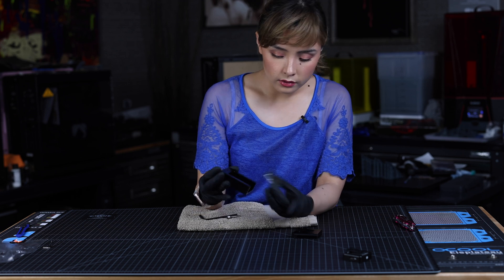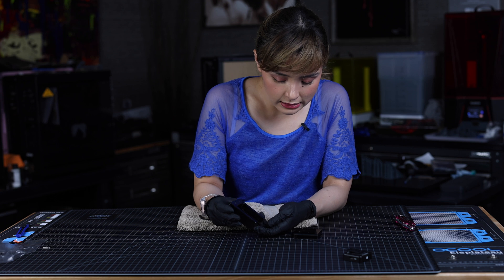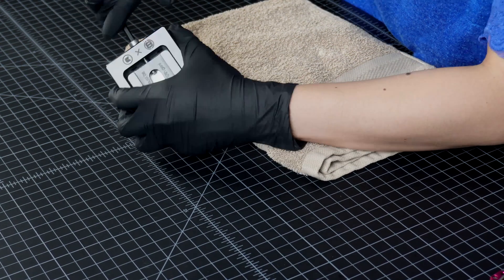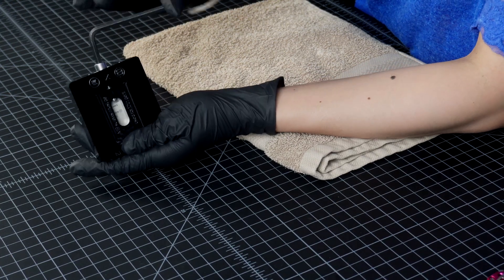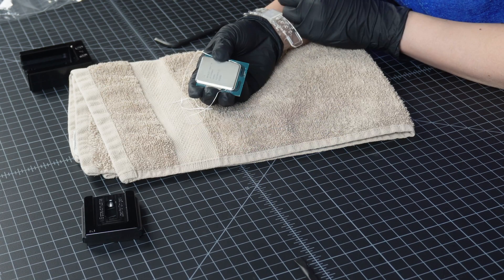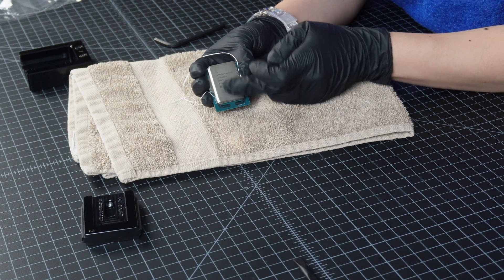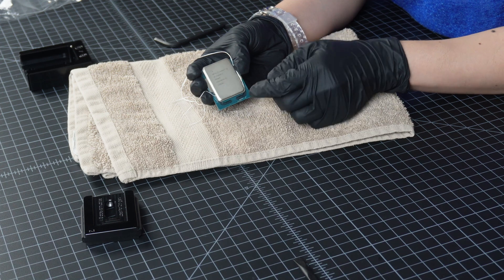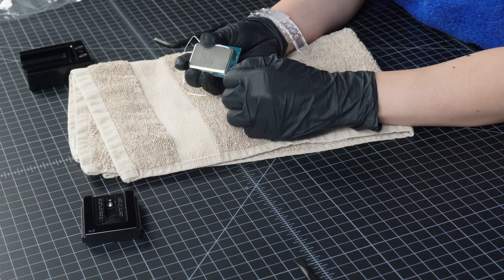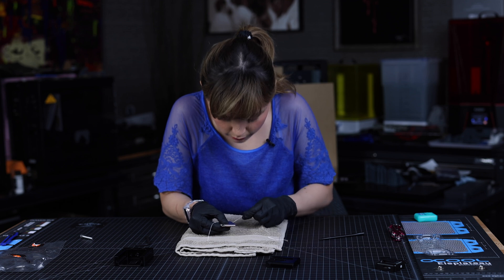Back to normal. Let's just do the number one pass again — so triangle number one, flipping the slider to where the number one is facing us. Now we're taking it out and we're going to take off the lid. Notice how I have the floss at the sides of the lid of the CPU and I make sure not to go in the middle at the indium part. That's because I just want to touch the adhesive around it and make sure that no adhesive is still sticking together. You want to make sure that the indium is the only thing that's left.